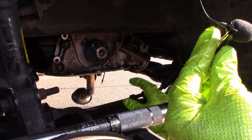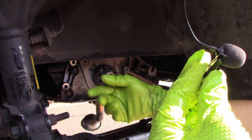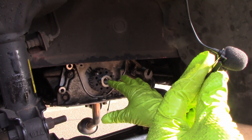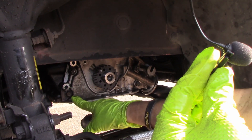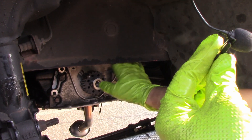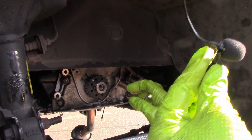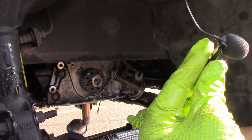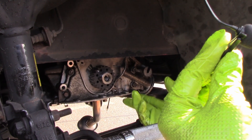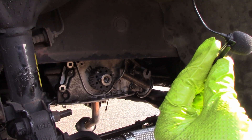So we have the oil pump put back on. I put a little bit of RTV again on the pump area, applied the gasket, and then we put it on the vehicle. These bolts are all mostly different sizes — that's one size, these are a different size, and the others are another size. So be wary of that. And then it's torqued to 17 foot-pounds on this particular thing — you can go anywhere from 14.5 to almost 20 foot-pounds, but I decided to go with something in the middle, like 17.